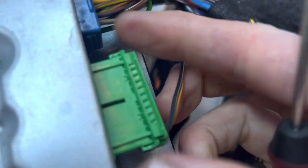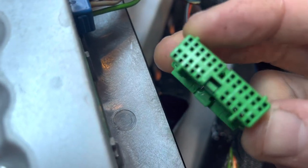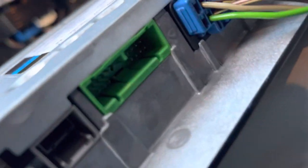That's that one popped - it's tricky to do with one hand. Always check the pins, and when it's completely out, check the pins in there as well, because sometimes you have to replace some of the pins in the connectors if the corrosion has been there a long time in the water.